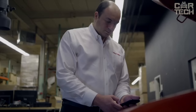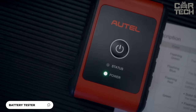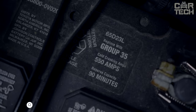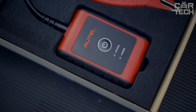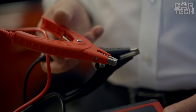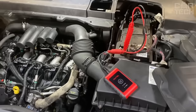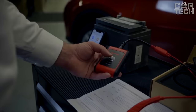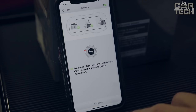An indispensable tool for checking car batteries. Compatible with 12V and 24V starter and alternator systems. Tests batteries at 100 to 2000 cold cranking amps, suitable for all types of batteries. Compact and easy to use — ideal for small workshops and home applications. Adaptive conductance technology is used for more accurate analysis. It increases test accuracy from 92% to 94%, reduces false measurements, finds batteries with low capacity, and reduces recharges and tests.